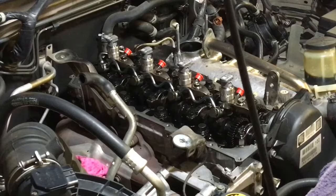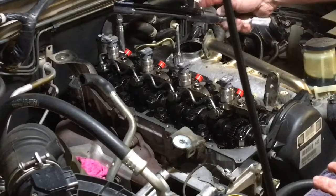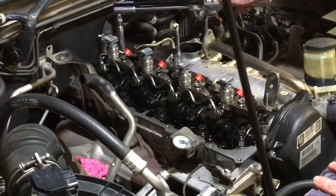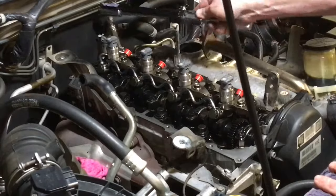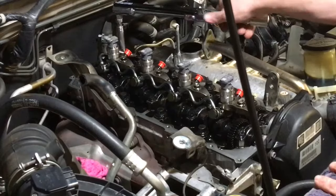Anyway, I don't want to bag other companies really, it's just what it is, but I told them their torque settings are wrong and they are in a good position to adjust it. That was years ago, 2-3 years ago, and they haven't done anything. Last time I checked recently, it was still 25, 25, 25, 25, 25. The actual torque specs are 13, 16, 22, and 35. They've got 25, 25, 25. Anyway, they do up that rear bolt to 25, this one here. And obviously, it must be able to take it because they haven't changed their thing. So everything can take 25, apparently. I don't know how their injectors go with that.